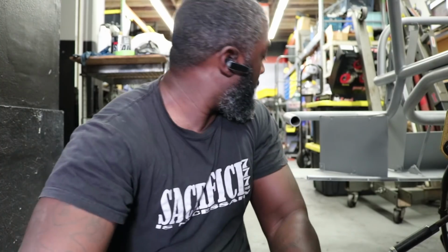All right, so we're about to get up under here and do some serious grind time, okay? So I got a surprise. We are going 6-speed T56. So there will be a T56 rebuild video coming very soon. I got a T56 from a 2002 Camaro. Unfortunate thing about that is it's got a hydraulic front part, so I'm going to remove that and change it for the LT1 front plate on the T56. If you guys don't understand what that is, you will soon, because I'm doing the entire swap on camera.